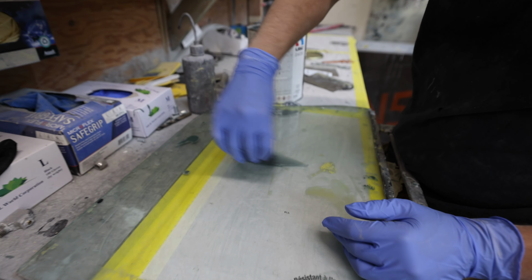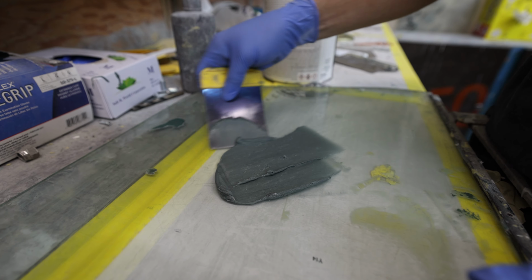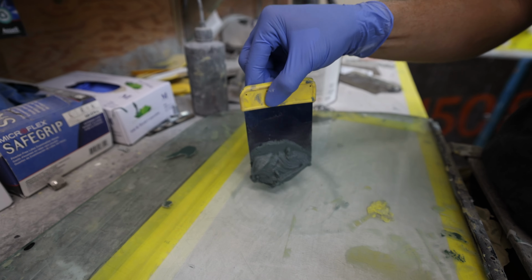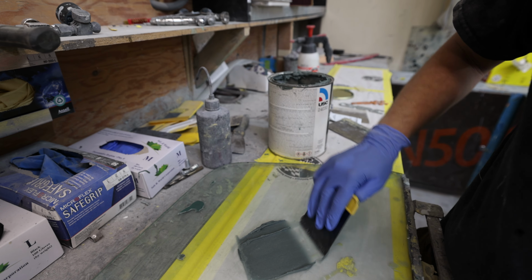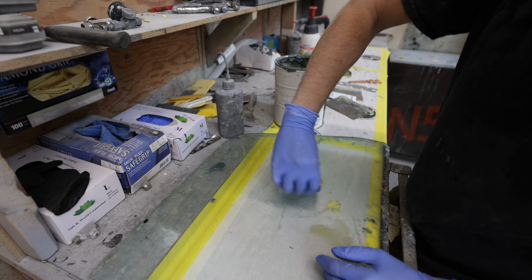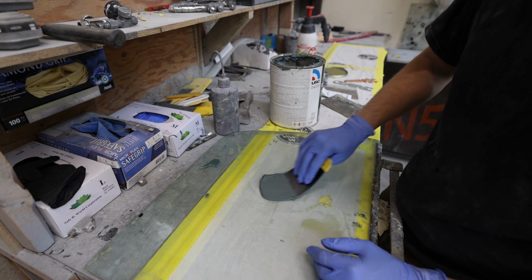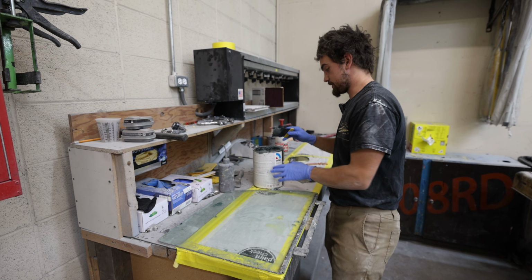So it's a little bit different than body filler. It's thick. It's not coming off real well. It's definitely thicker than regular filler, and it's stronger, significantly stronger. So we use it in places that we need a little bit more than feel comfortable just putting filler. Works remarkably nicer than some other products.